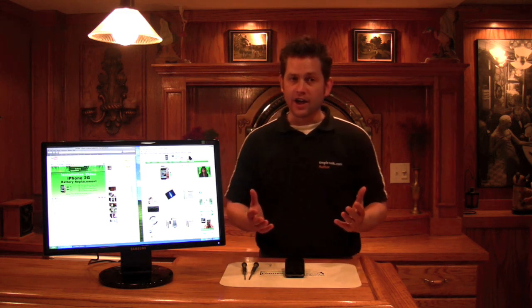Hello, welcome to our battery replacement video for Apple's iPhone 3G. The case design of the 3G makes it easier to open when compared to the original 2G model. However, the battery is located in the bottom of the back shell, which makes it difficult to access. The system board along with a few other components need to be removed in order to gain access to the battery bay. Fortunately, no soldering is required to replace the battery, unlike the iPhone 2G.